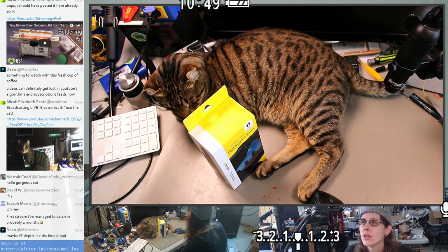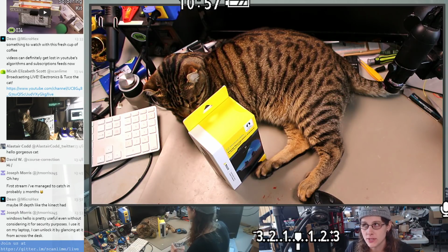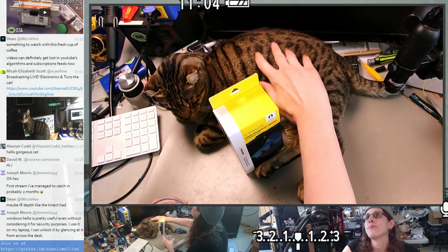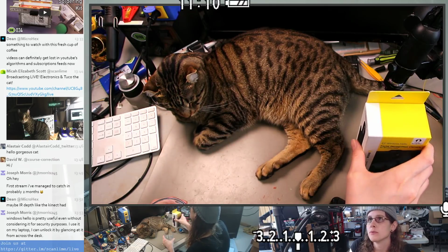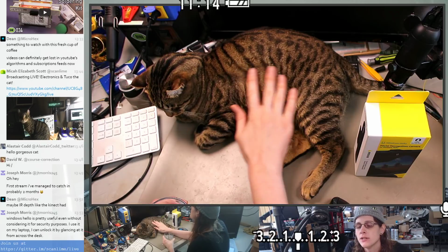So if you want a way to log data without having to shell out for expensive hardware, then it could be compelling to look for a way to do this in software. And so then that starts to depend on what operating system and what environment you're dealing with. If you're running everything on Linux, these days it has some USB logging support built in that you can even use with Wireshark, so that's pretty convenient.